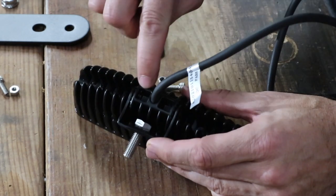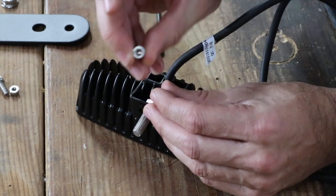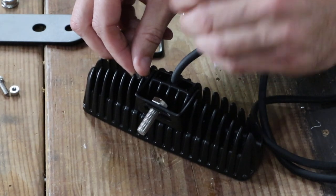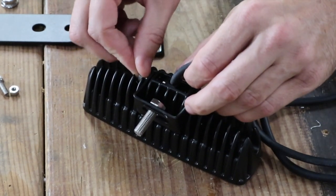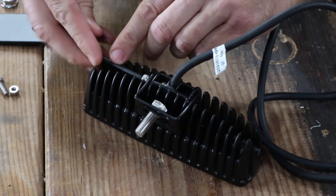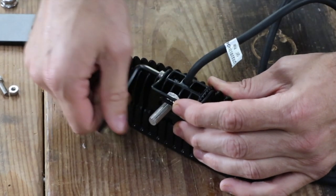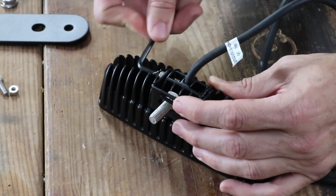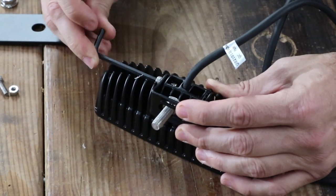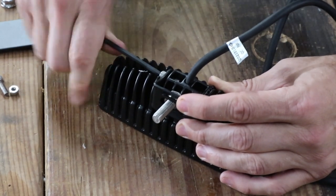Here's the really challenging part. This little squared-out portion right here receives this little nut. This allen-keyed machine screw here comes through the bracket and into there, and you have to somehow hold that nut, get it aligned, and then use the allen key to try and thread it through. There's no other way to turn this little screw — you can go through the fins but only for about a quarter turn before you're running into the next fin. So you need to stick the allen key in long and actually turn it. In my opinion, that's a terrible, terrible design.